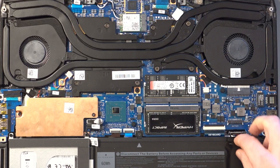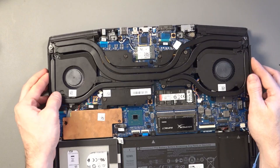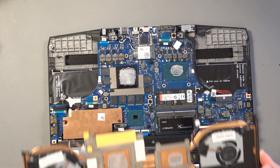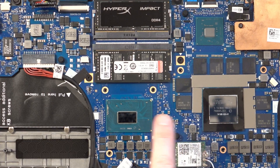The actual upgrade is very straightforward. You open up the back of the PC and take the heatsink off, and then you will see the CPU and the GPU. You clean off all the previous thermal paste that was applied — get all of that off and make sure it's all been taken away.